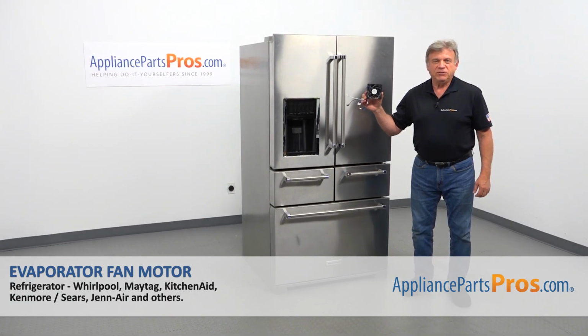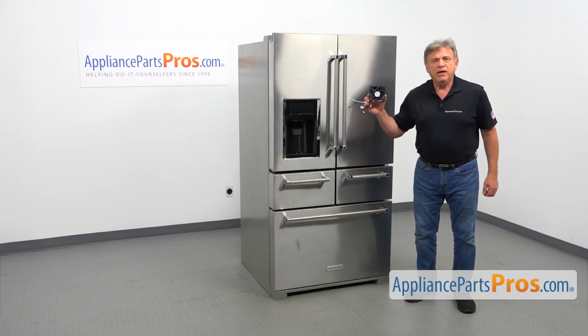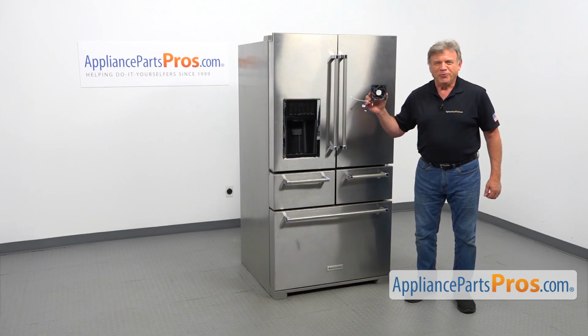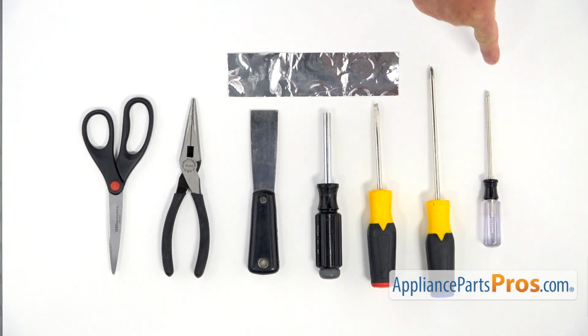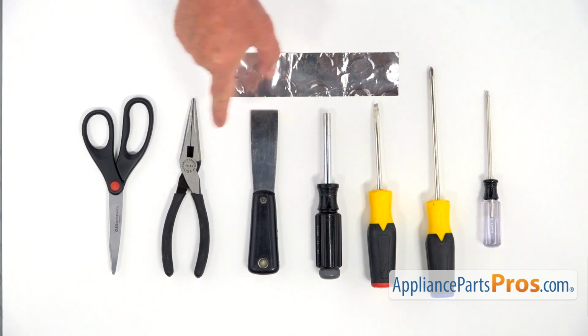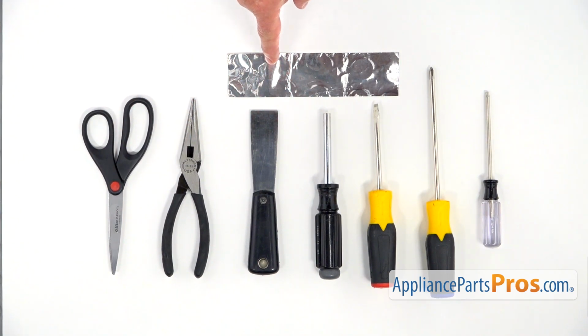In this video, we'll show you how to replace the evaporator fan motor in a KitchenAid refrigerator. It's going to be a very easy repair. Should only take a few minutes to show you how to do it. For this job, we're going to need a Torx 25 screwdriver, a Phillips screwdriver, flathead screwdriver, a 1/4-inch nut driver, a putty knife, a pair of needle nose pliers, scissors, and a piece of aluminum tape.